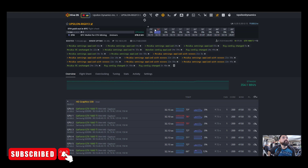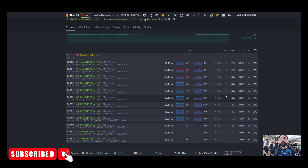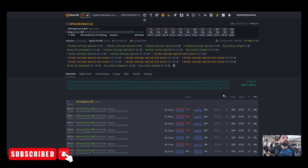We are coming up with 378 mega hash for this entire 12 GPU rig. I've always wanted a 12 GPU rig — it's just massive reuse of the same motherboard, hard drive, and base rig hardware, and you get all the GPUs on a single motherboard, saving a little money and power. The main board itself uses between 100 and 120 watts on top of the GPUs, so if you have a single motherboard powering 12 versus just 6 or 8, you might need two motherboards otherwise — you're saving at least 120 watts when you stack up 12 GPUs at once.